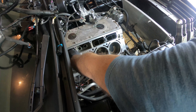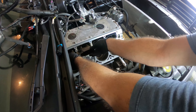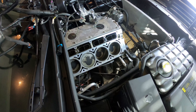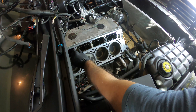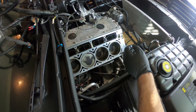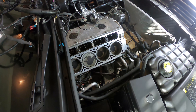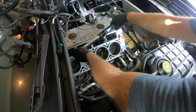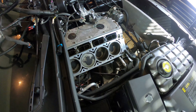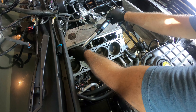Next set of lifters is going in. Here they come — and there they are. I again applied some Loctite to that bolt, and we're going to screw it all the way in by hand. Next we'll torque it down to 106 inch-pounds. There it is. Let's just double check this one one more time. Good.